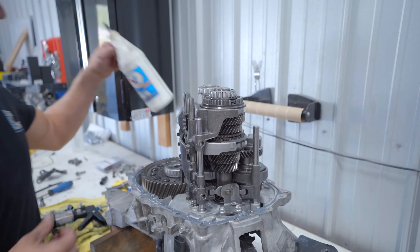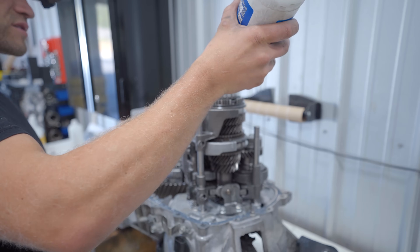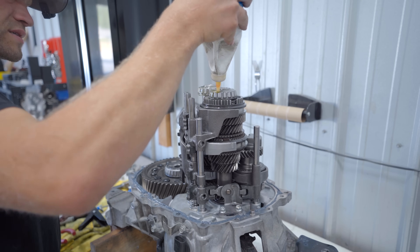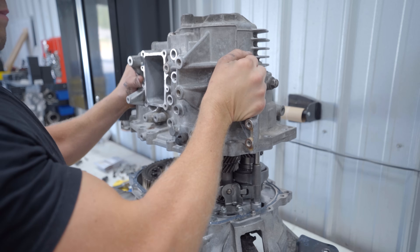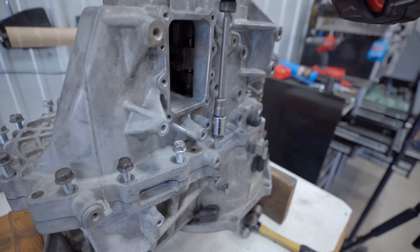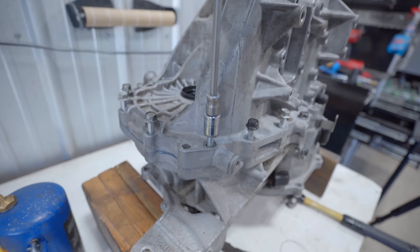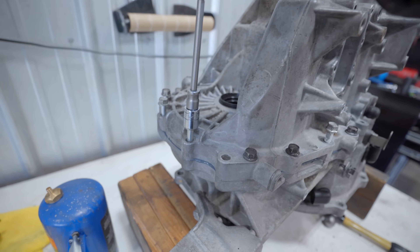Let's toss a little bit of gear oil up in here. Of course, make sure to not get any on the gasket surface — that would be a bad day. Just let it drain down the stacks and lather up those bearings. The nice thing about this 3-Bond is you don't need to give it that 30- or 45-minute wait time like most sealants. Instructions say to apply a thin bead and assemble.